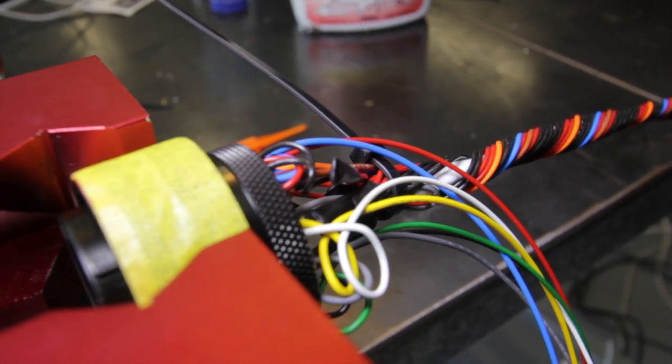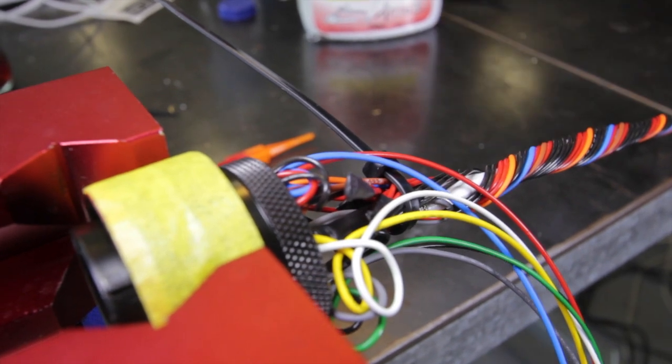The great thing about this is you can take the whole engine out — it's just a quarter-twist connector on the firewall and the whole loom comes out with the engine. It makes it really easy to work on the car; it saves you having to disconnect every connector, injector, and coil plug on the engine every time you want to work on it. So that's really handy.